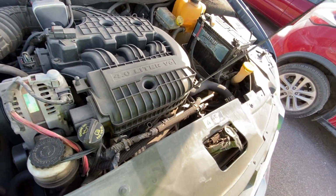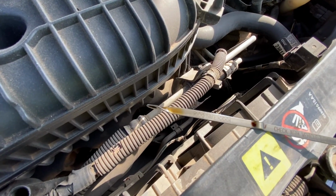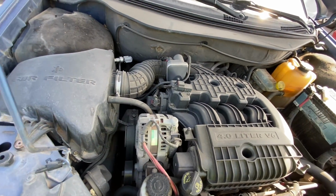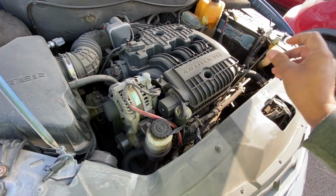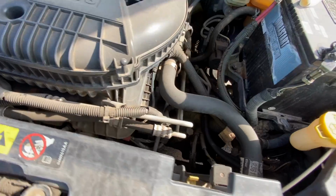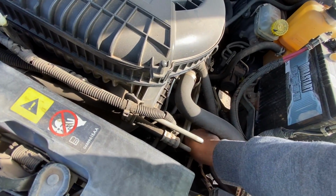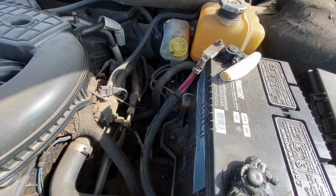Somebody shoved a screw through the dipstick because the dipstick broke. And it does have oil. And in fact, the oil actually looks pretty dang good. Okay. It's got power steering fluid too. Things are looking really good so far. Now all we got to do is find the transmission dipstick. I think they still had one. Or did they? Nope, they did not. No tranny dipstick, so you can't see what's going on with the transmission.